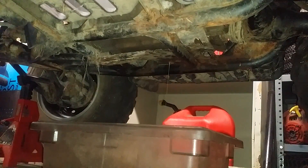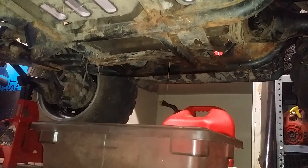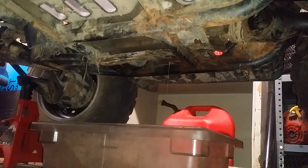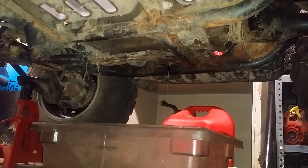We're about empty here. Just going to let you know that I did let this four-wheeler warm up for a few minutes — it's not really hot, just enough to stir everything up. The oil filter on here is a screen. It's over on the clutch side of the motor, and Honda recommends to clean it every thousand miles or so many hours. I haven't had the bike that long, so I'm not going to change it. Next oil change I may change it — I'll make another video on that. It's about time to put this oil plug back in.